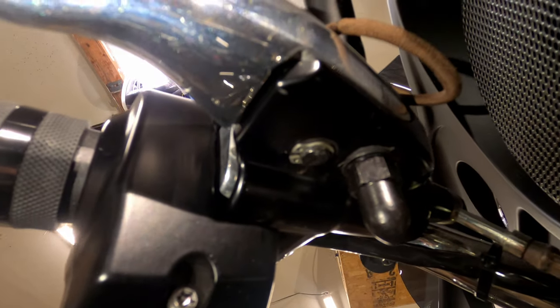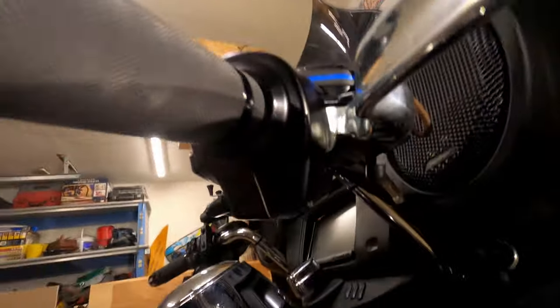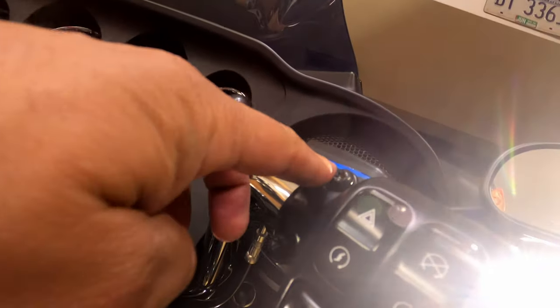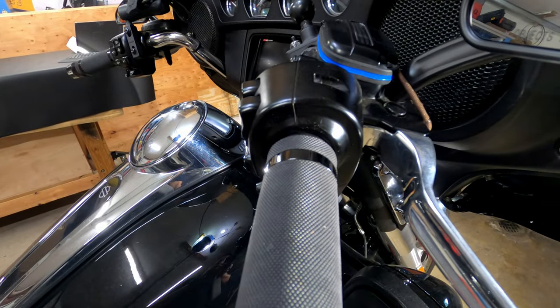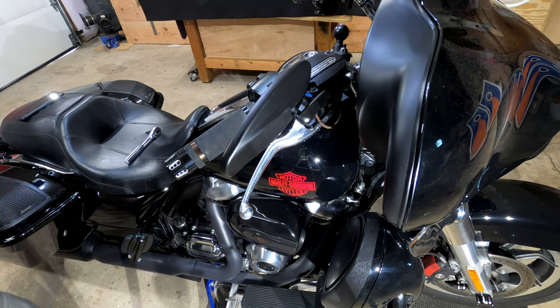I'm going to try to give you a quick explanation. Dead center of the screen, you see a little snap ring. That snap ring comes off and it holds this retaining pin. Once you get that retaining pin loosened up, come to this side and remove your T27s on the front and back of the switch pack. The bike is up on a jack, but it's not necessary — you don't need a jack or a lift to do this. I just did it so the bike is upright and not leaning.